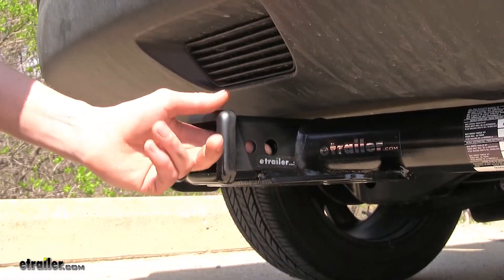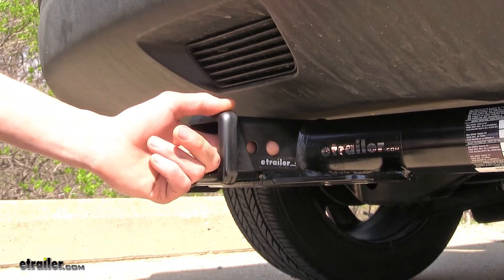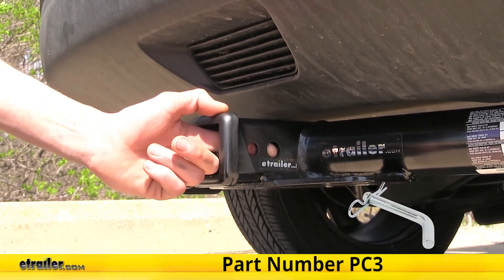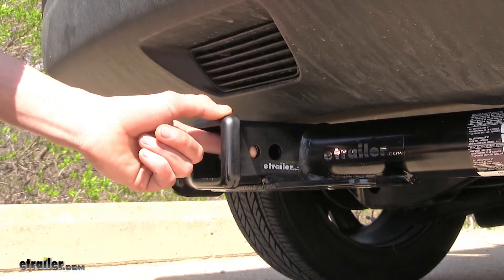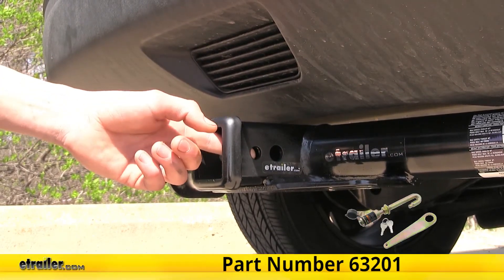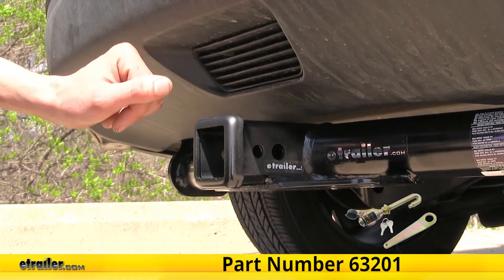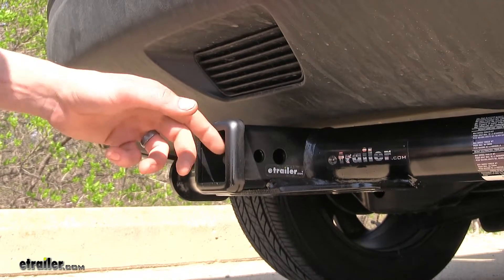On the side of our receiver, you'll find two pinholes — the larger diameter one closest to the front of the vehicle is our industry standard five-eighth of an inch diameter hitch pinhole to secure our hitch-mounted accessories. You can pick up a pin and clip separately on our website as part number PC3. The smaller one closest to the rear is for a J-pin stabilization device, which takes away the annoying shake, play, and rattle out of what is inserted into your receiver. You can pick up one of those on our website as well. That is one unique feature about this hitch — other hitches don't have the J-pin hole.